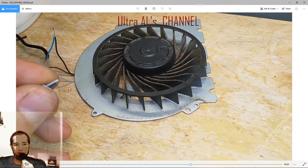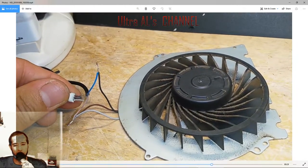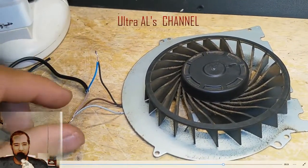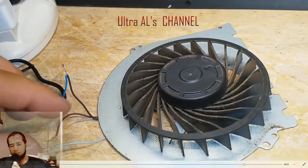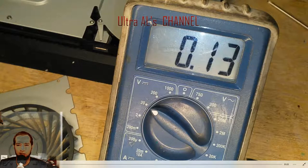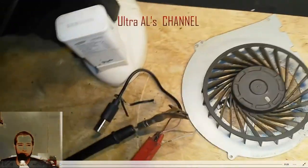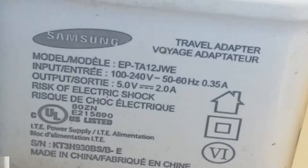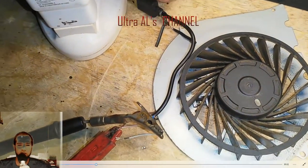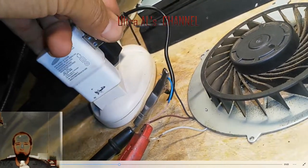I ended up testing the old fan with five volts from a USB and a wire. I figured out the black wire is negative, red is positive, and the gray/green wire is the control wire — it controls the speed. When I tried the fan with just five volts to positive and negative, it didn't work — it would just kind of spin and then stop. I'm guessing it needed the control signal. Testing around with the meter, I figured out that if you plug the control wire to the five volts, you will get the fan to spin.